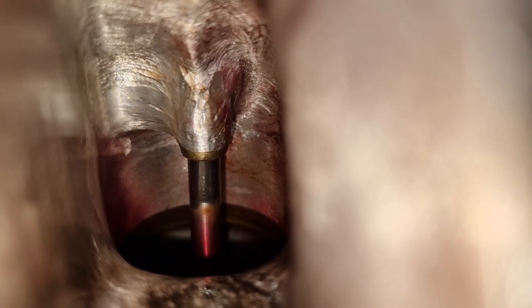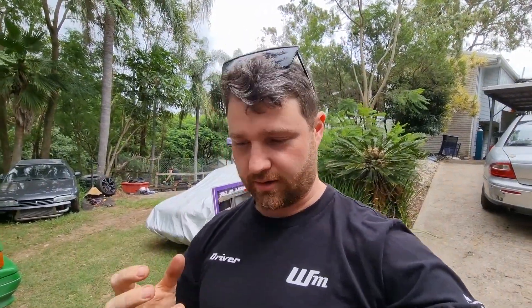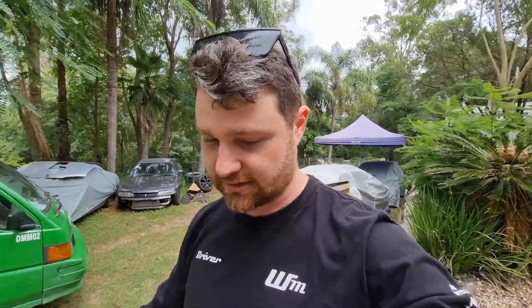You can tell a professional did that. Right down near the valve you can see the actual good bit - the bit that I had paid to get done, which is the important bit. It's the area around the valve. It really helps low-lift flow and all that. In my opinion, this is the reason why this motor makes so much power - because of these heads and all the work done to the valves, de-shrouding all around.